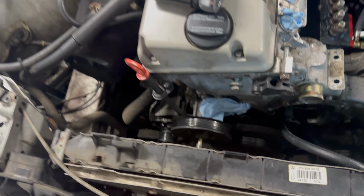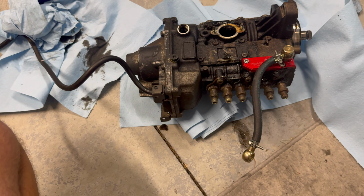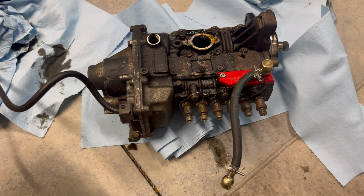So on the new injection pump, we're gonna take this plate cover off of the old injection pump, put it on the new one, and then yeah, we're 1 step closer to having this 8mm Maya, however you say it, with the 8mm elements on this bad boy. All right, don't forget to remove this ring. Ours was actually stuck on there, so we peeled it off, and we put some rags around this where the pump goes, and we have a plastic razor blade, and we're just scraping that mating surface. And like I said, we're one more step closer to putting this 8mm injection pump in.